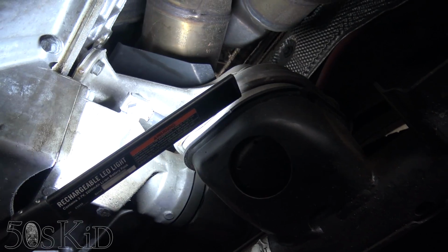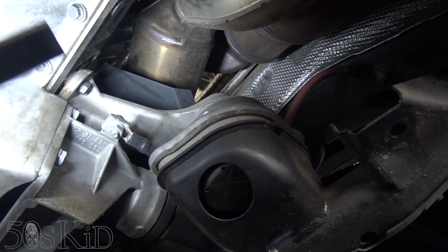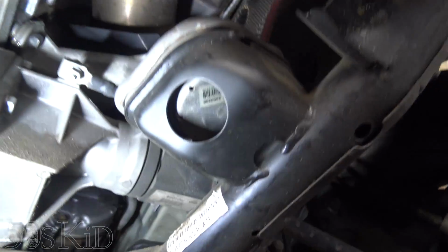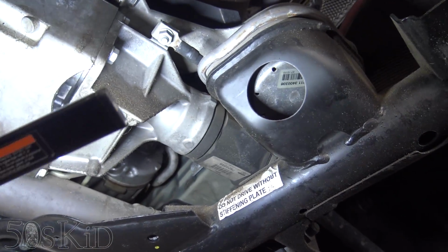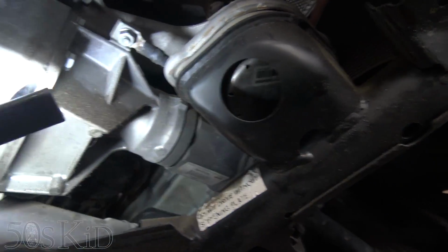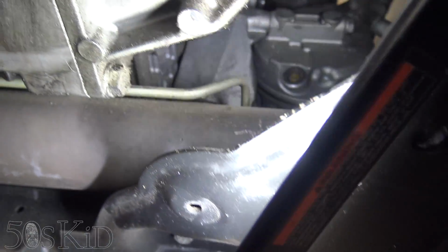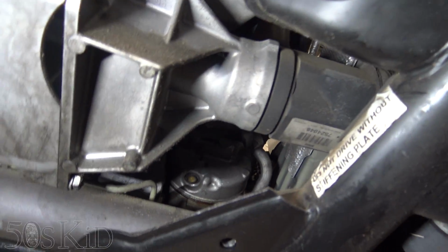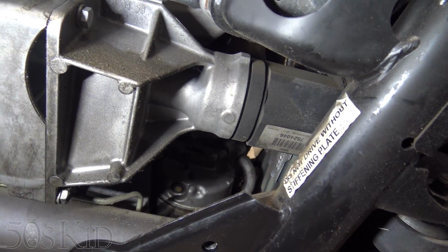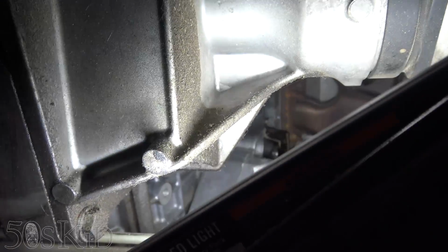This is the engine mount right here. You can take off the engine mount bracket, which is usually what you have to do with an E46. And since this is all-wheel drive, we would need to take the CV axle out, and also the carrier right here. The carrier is bolted to the side of the pan: 1, 2, and then 3, 4 along the front. I would remove those just so I could get access up in there and remove the bolts for that manifold.